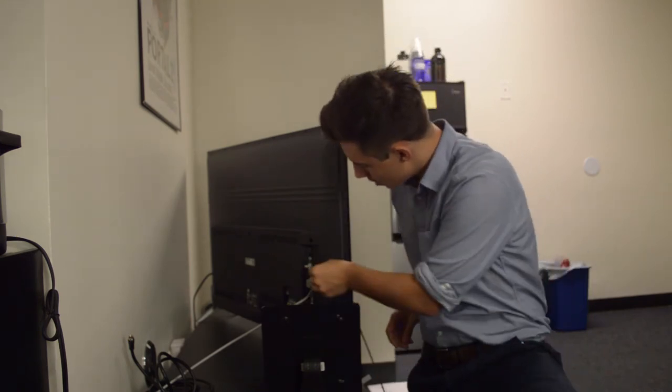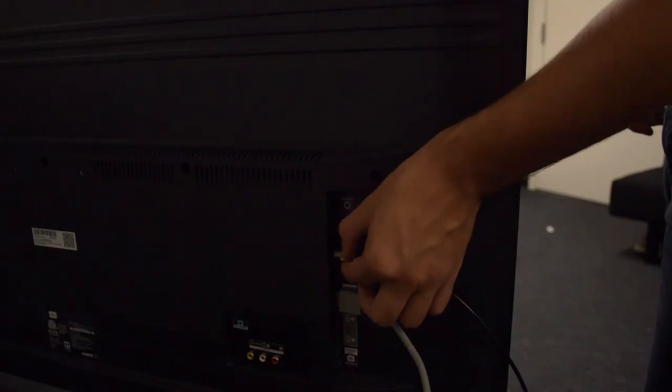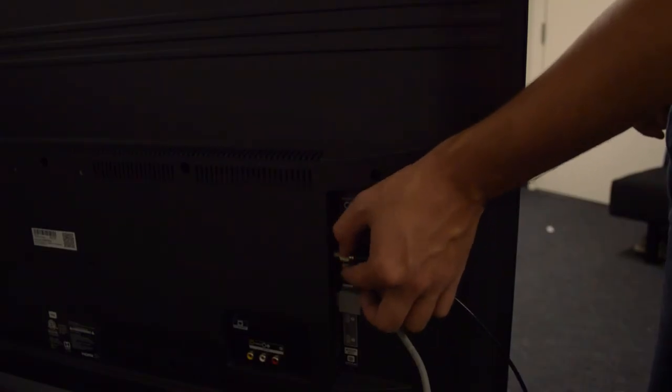Then all you have to do is screw it in to the coaxial input on the back of your TV or other multimedia device that will feed the TV. And now all we have to do is go to the settings on the TV and set it up. For this TV, go to Settings, then Set Up a Signal, and then Find Channels. This will take a few moments and when it's all done, we should have a bunch of local channels to scroll through.